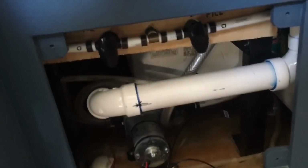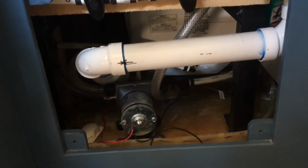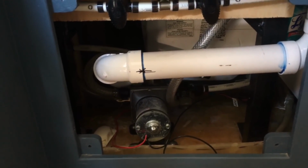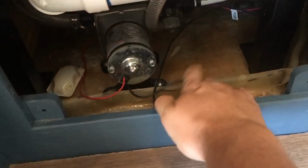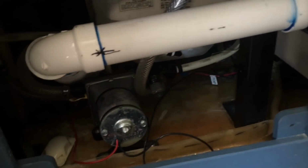And this comes out and you can see there's all of the plumbing, PEX, except there's some vinyl tubing connecting to the water pump, and actually that one right there in the center is the overflow vent. There's a fiberglass pan that I made under here. Pull that back out and show you. So all the plumbing is in this pan, which can drain out. So if there's a spill or something breaks, it shouldn't flood the whole kitchen, it should just drain out.